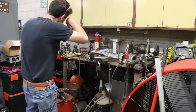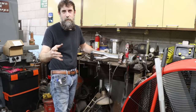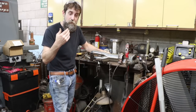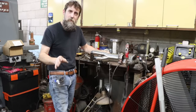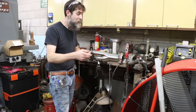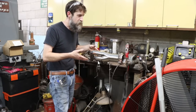So I just got done butchering this set of headers. The passenger side fit great. Well, I say great. I had to trim off a little bit of the ear of the transmission. Also had to relieve the frame, about an eighth of an inch in a couple small spots. But typical header woes. Driver side, not even close to fitting. In my defense, I bought the wrong ones.